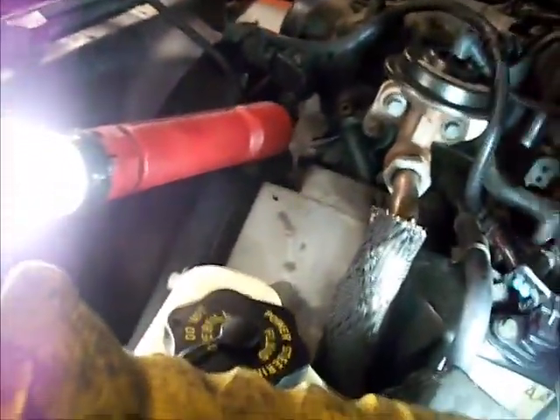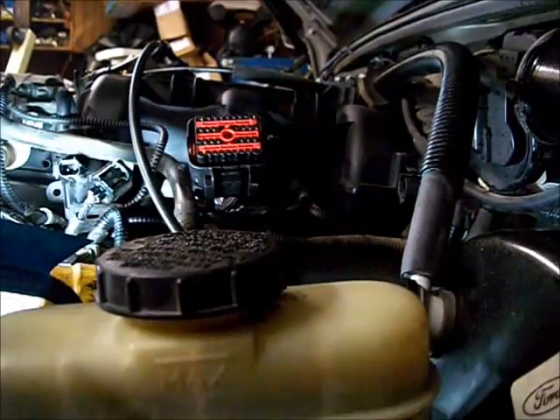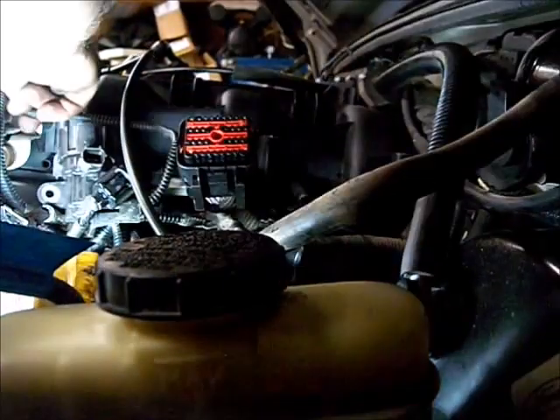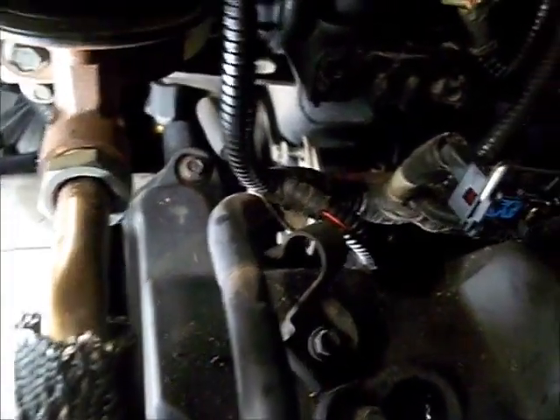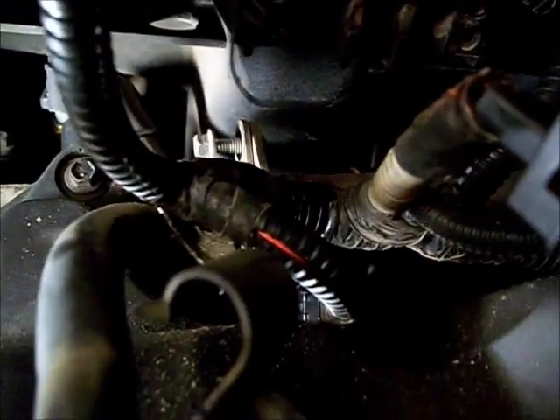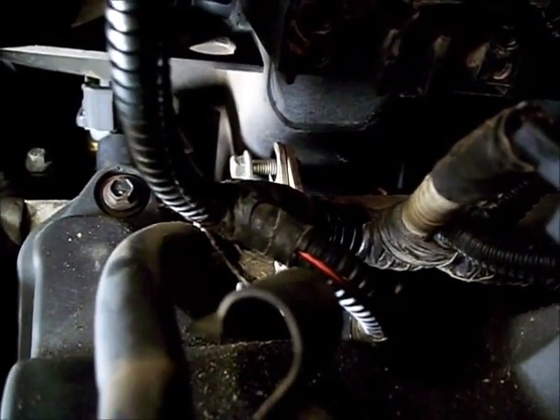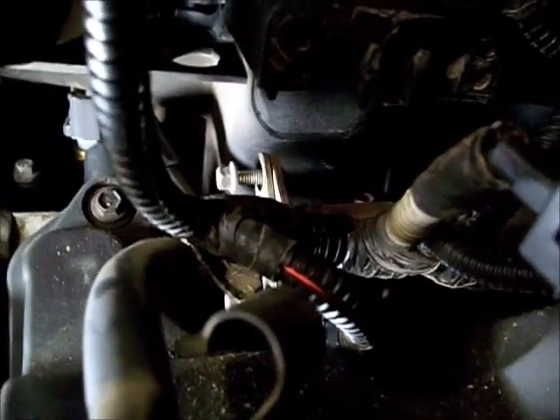Don't break a nipple off the plastic — I'm going to have to deal with that. It's fastened here on this bracket; I could probably just take that bracket off the valve cover and get both of them. Unclip the evap line and take the line off the EGR valve. I'm going to disconnect the fuel line at the fuel rail — I recommend putting a shop towel under and around it before pulling it loose, so you don't get fuel in your eyes or all over the engine.